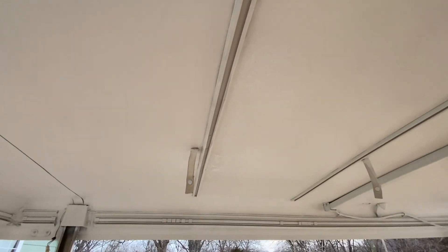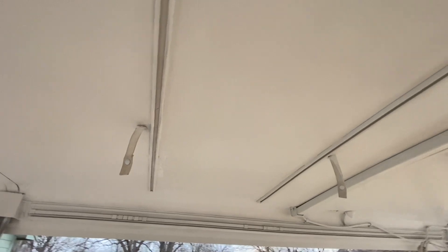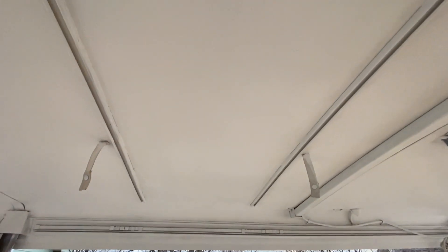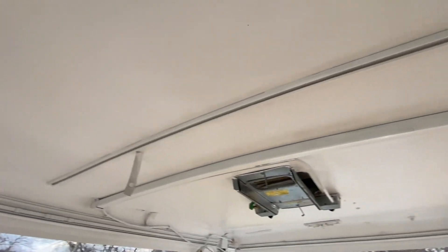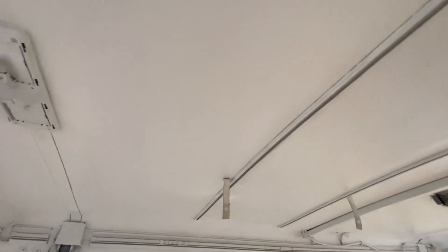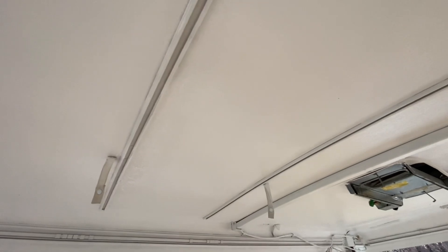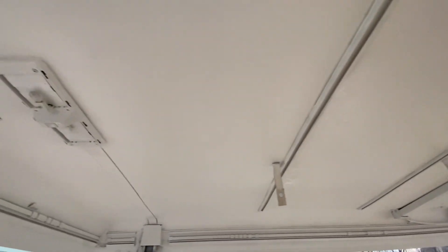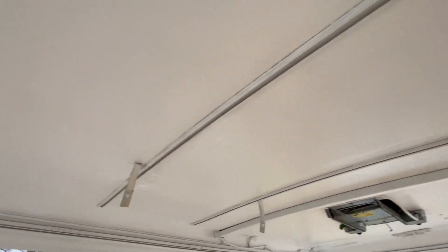At the beginning of the video you probably saw where I had the Bondo pieces because this ABS plastic was cracked and falling down. So I put some Gorilla Glue epoxy on the underside of it and took small screws, making sure that the epoxy was on the screws when I screwed them in — in the threads — so that it would stay up and hold. Then I set the epoxy in place.